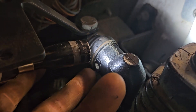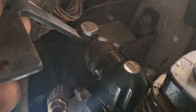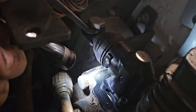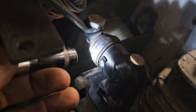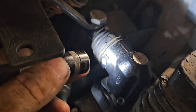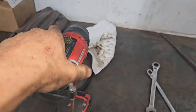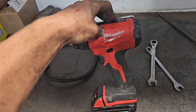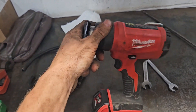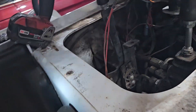There's just a little arm that pivots on that rod, and that rod is pressed into the ball arm. When you push up and down on this thing, that center actually turns. The pivot point is in these cheeks, one on each side. All I did was jam as much lithium grease as I could into this cavity where the arm goes in. I wiggled that arm back and forth, then used a heat gun — you could probably use a torch — to persuade the grease to go into the crevice. Just make the grease get into those pivot points.